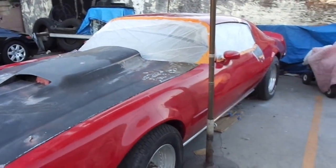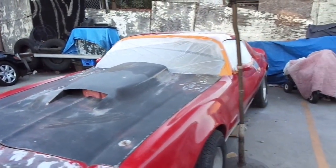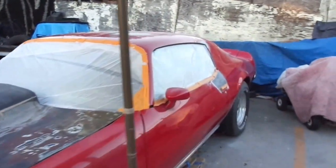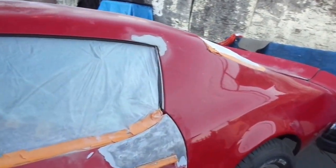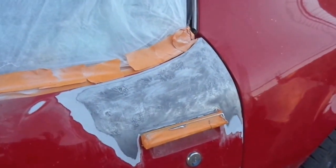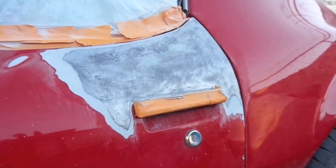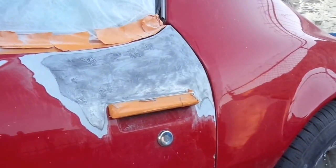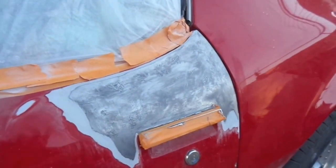This car has been in rain and the paint oxidated with cracks, with minor and major damaged spots. Like this one, just by the driver side on the door panel. I grinded and sanded it down. I didn't find much rust, only surface rust, so I removed it and before I left in the evening I put the stop rust on it so it would not rust again.